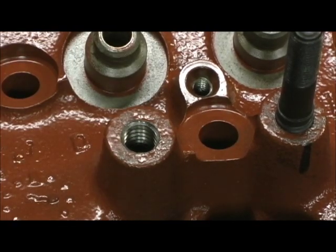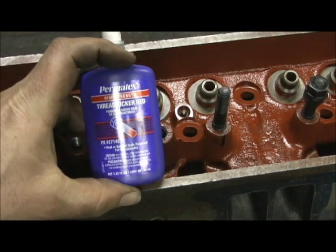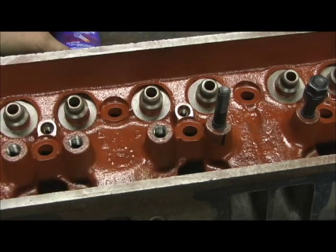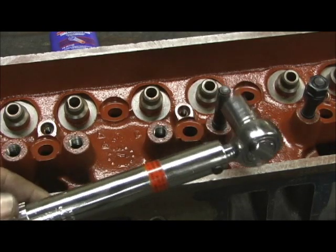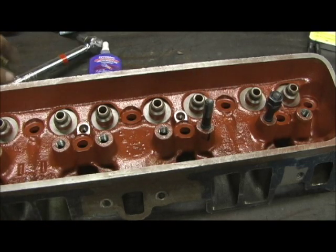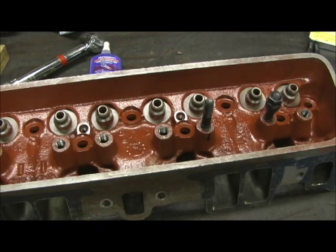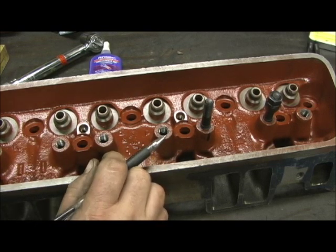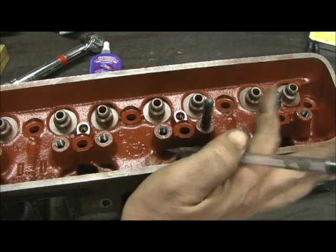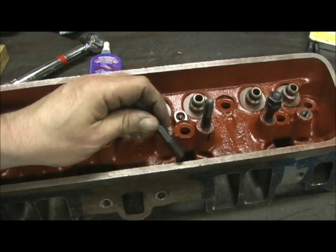The amount of torque I use is a little different from what some say. I use Loctite red or Loctite green — I like green but I'm out of it right now. I use an inch-pound torque wrench and pull it down to 26 pounds of torque. The regular torque if you have a wrench-head base is around 60 pounds. Start climbing much over 26 to 30 pounds and there's a big chance you'll bust it — and if it can't be machined down, the head is junk. Keep it around 25–26 pounds on a non-wrench-head style stud.